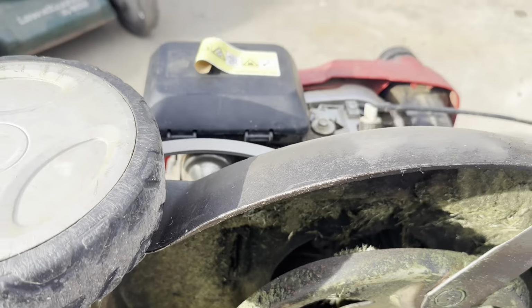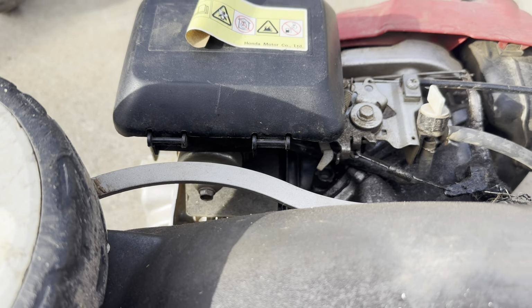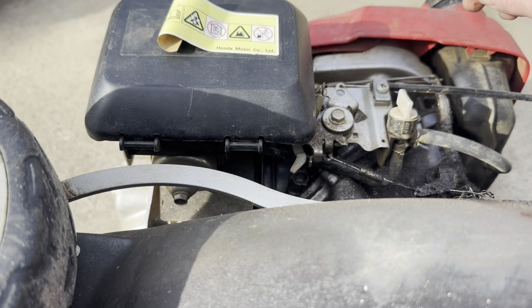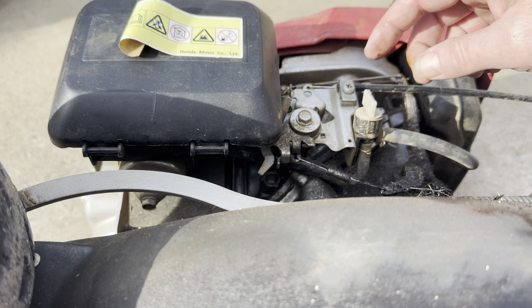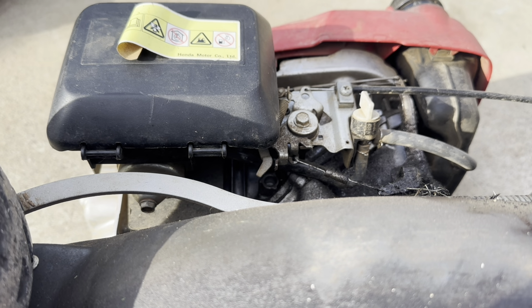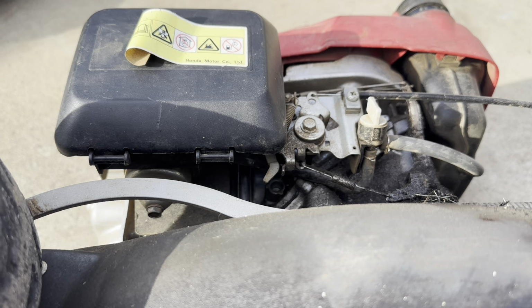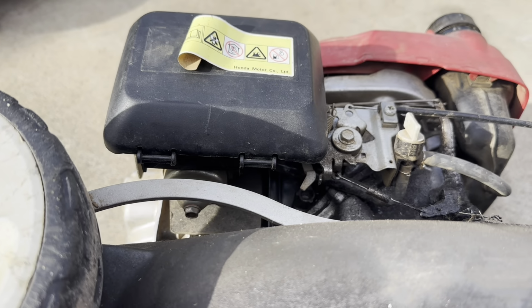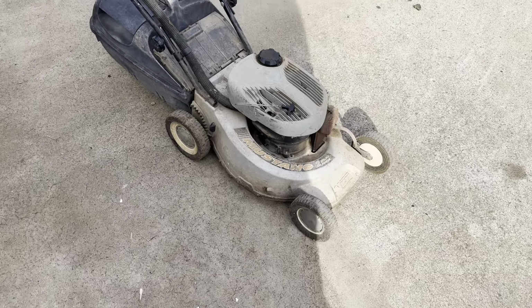There's also a possibility there's some carburetor issues that will need to be looked at. Because when we picked it up, the fuel tap was off, and a lot of them go off on them. The fuel tap's been left on, and when they've been turned off, they turned off for a reason. So it's a possibility all this flooding has been from bad float. So while that one's sitting there running, we'll have a bit of a look at this one, eh?